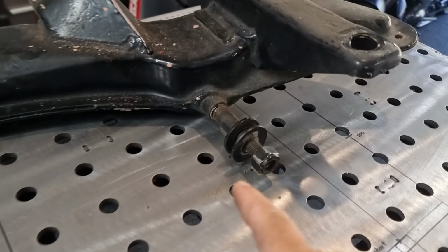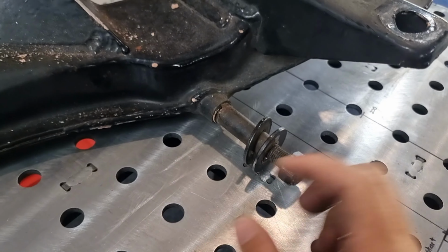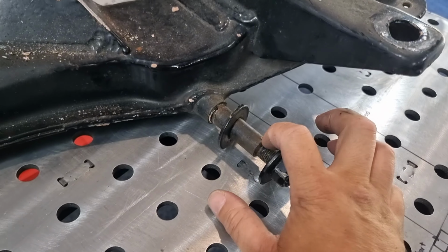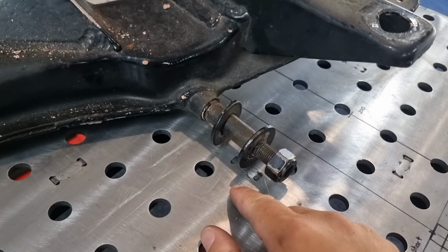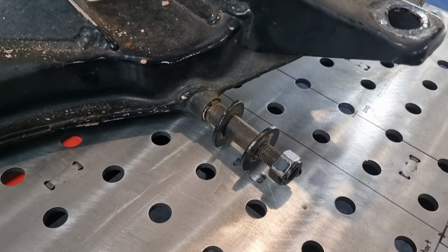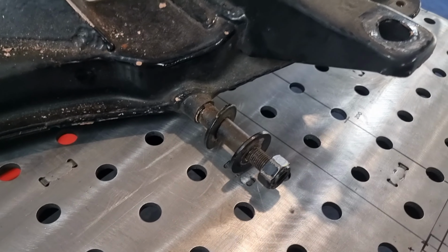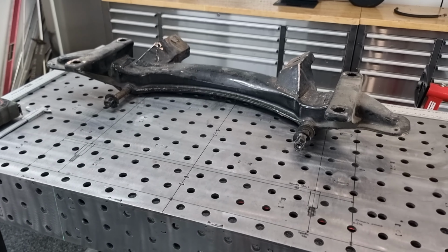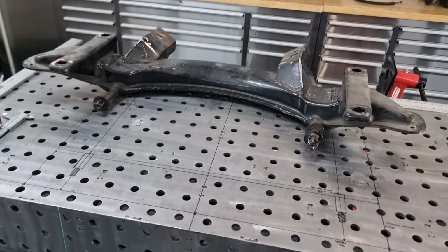What we're going to be doing also is we obviously have to make some new spindles, and how we're going to be doing that is we'll get a bit of billet, we'll turn down our diameters, and then we'll be thread cutting, so you might find that quite interesting. Hopefully our little lathe is capable, it doesn't have too much backlash, it's an old second-hand unit, and we'll do a test piece, and if it's sweet then we can do the thread cutting and be good to go. So yeah, we should start folding some metal and bending some pipe and drilling some holes.